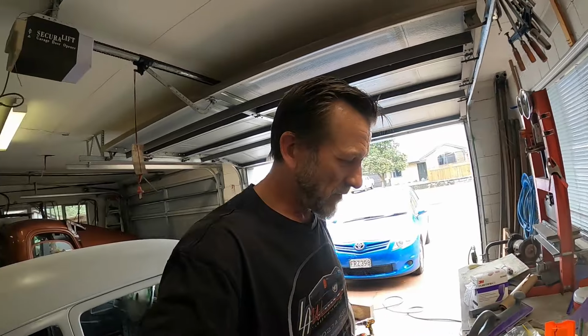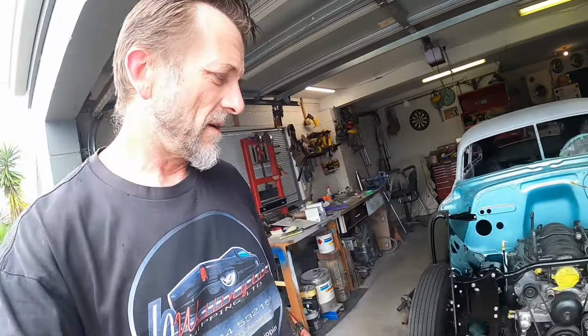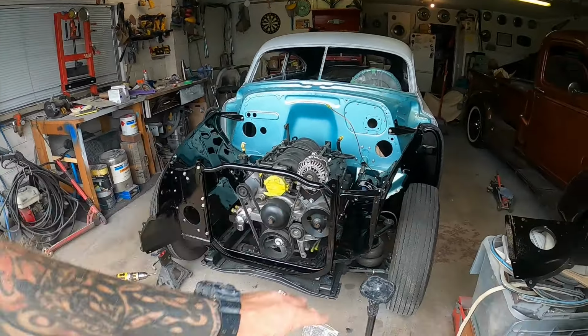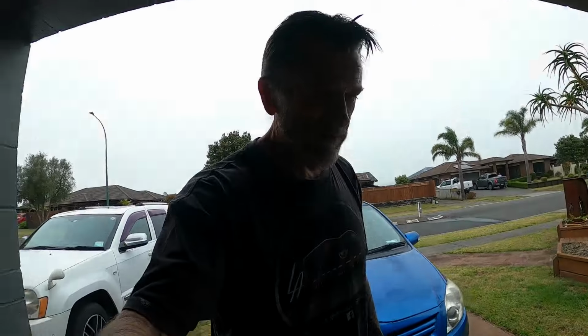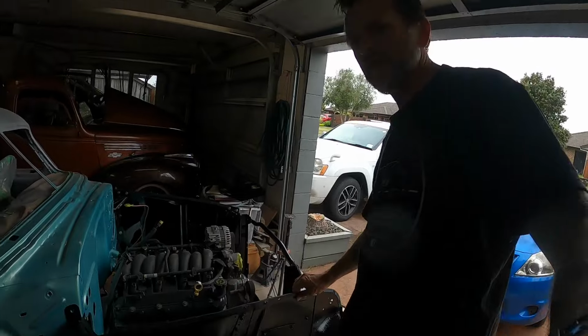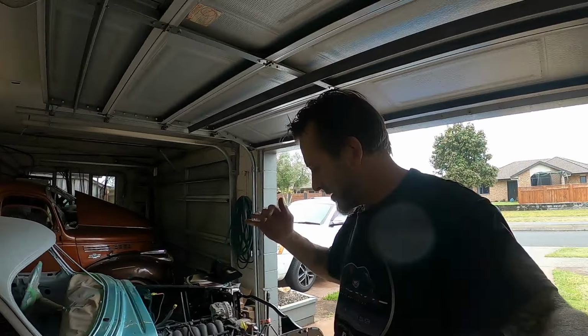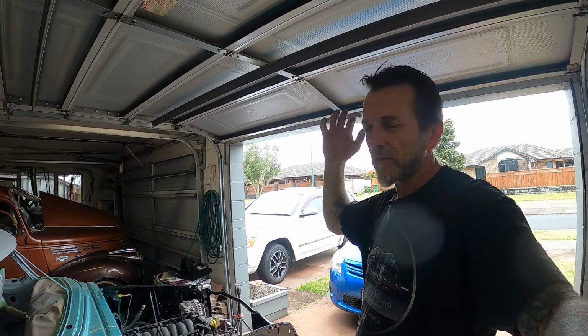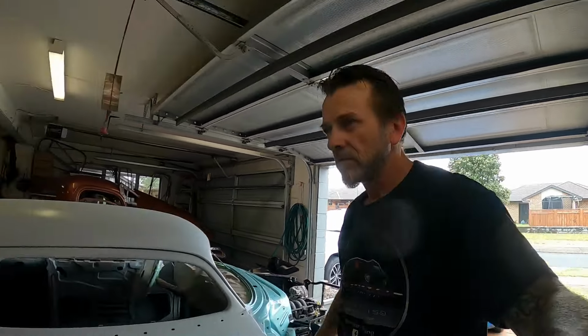Okay, right. All that was surprisingly more difficult than I anticipated, and now I have to repeat the process over that side. But now I kind of know what I'm doing. The rivnuts are definitely the way to go in this situation. I just didn't have anything else that would do it. I tried screws and pop rivets and just ended up scratching things, and that didn't work. Holes were too big, rivets were too small, that kind of stuff, so it's just easier to drill them out